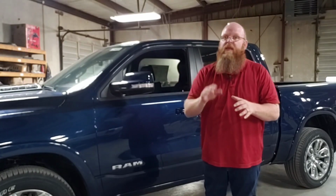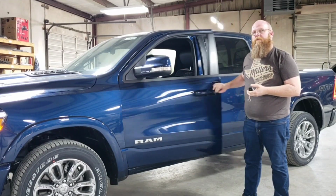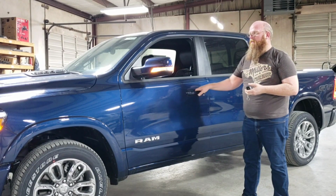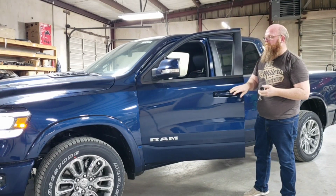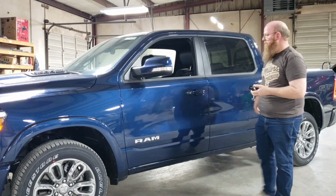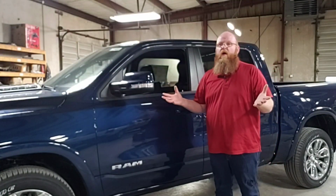This next one had me thinking I found a way to turn this setting off. After that initial set of 3 honks, you can open the door back up multiple times as long as the key fob hasn't been detected back inside the vehicle. And the horn alert won't be sounded again. Now, even though this is a way around the honking, is it feasible to hold the key fob outside of the vehicle as you close the door?